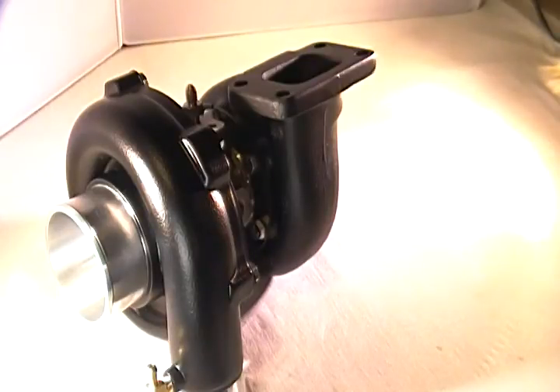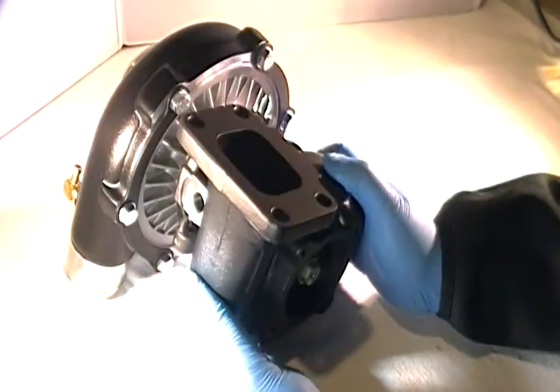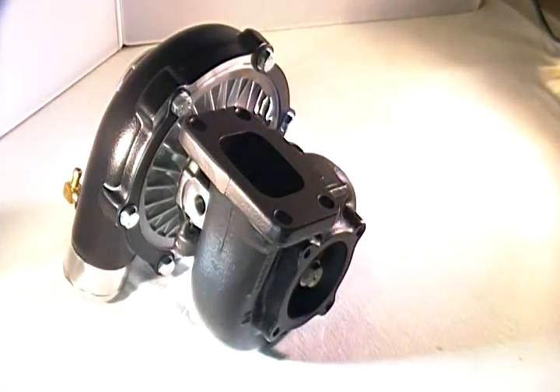For the effective RPM range across all three categories: in the four-cylinder category, the effective range is 4,200 to 9,000 RPM for 1.8 to 2.5 liter engines. For the six-cylinder category as a single unit, you're looking at 3,800 to 6,800 RPM for 2.5 to 3.7 liter engines with at least a better intake camshaft and higher lift and duration, retaining strong mid-range power and drivability. For the eight-cylinder category as a single unit, the effective RPM range is 3,200 to 6,800 RPM for engines of about 4 liters or larger.